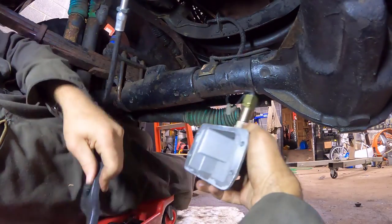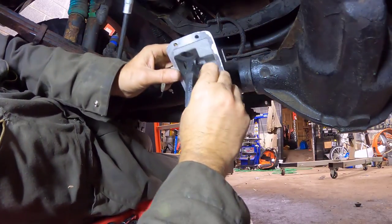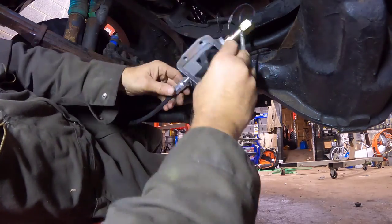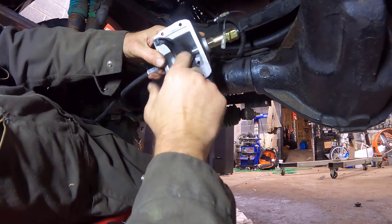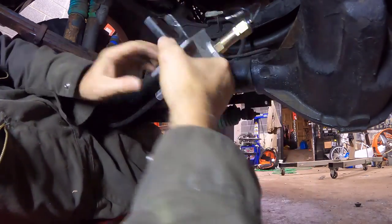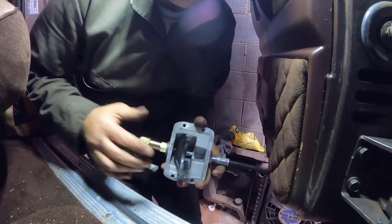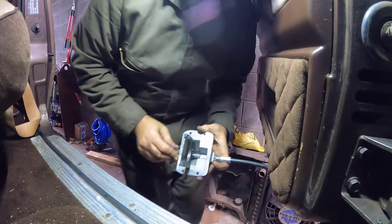Now, we gotta route cable and shift fork. Remember, the offset in the shift fork goes like this in the housing, so it can move back and forth. There's two E-clips, and there's a third E-clip. I put this all together. It's much easier to work on this outside from under the car. It's on a cable, so don't even bother working on it down there.